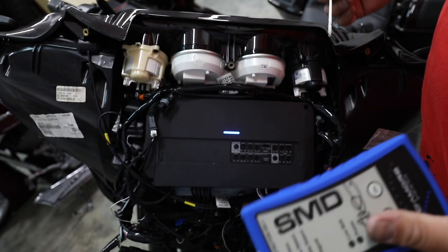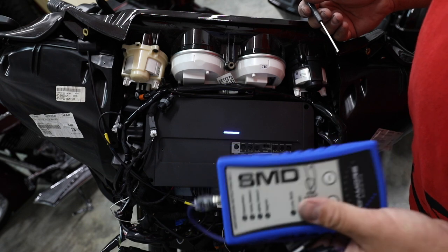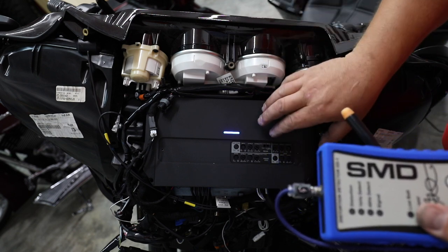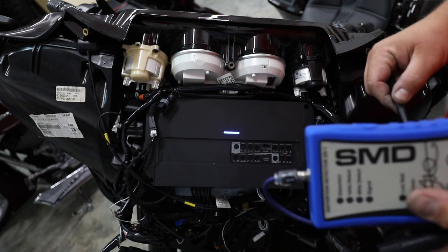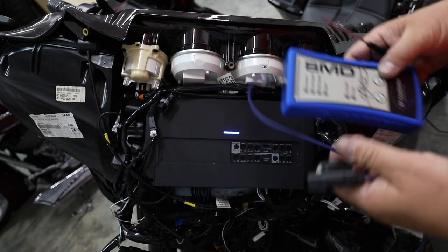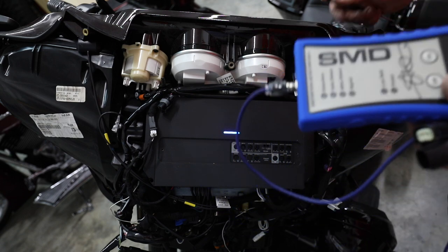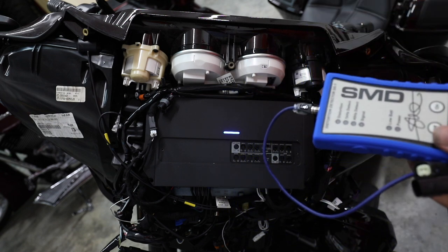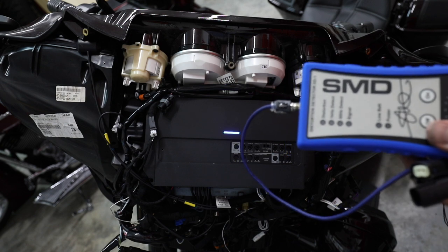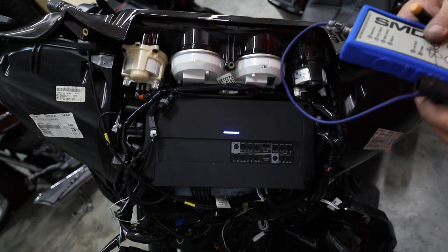If you're not already subscribed to our YouTube channel, go ahead and subscribe now because we're going to be doing a whole video series on how to flash your radio and what each one of those flashes does. Once we've got our radio flashed, we have to play a test tone through our amplifier. We need to bring our radio up to the correct listening volume — the loudest clean volume for the radio. On a GTS radio, it's normally almost all the way up — actually two gray dots on the screen from being full volume. Go all the way up to where there's two dots that aren't highlighted, and that's where we're going to set our gains on our amplifier.